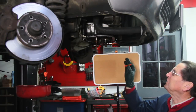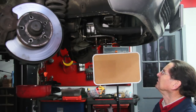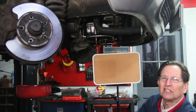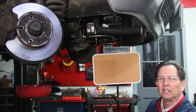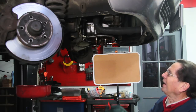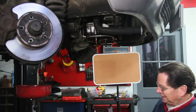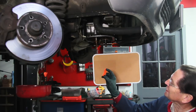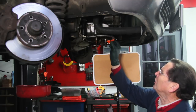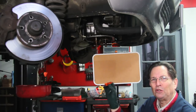You can see I'm under old Fritz here cleaning off the residue of that pan gasket. We've got to replace the pan on this engine, and one of the best tools to use for this is a plastic razor blade - you do not want to scratch the aluminum on the upper pan section. Most plastic razor blades are small like this, but this is the one I like - it's the same size but wider and much stiffer. So when you go to scrape really hard gaskets, this super plastic razor blade does the job. This is my favorite tool of the week.